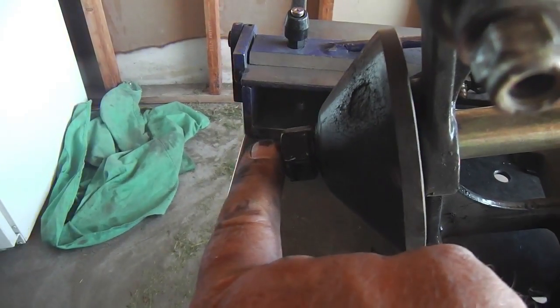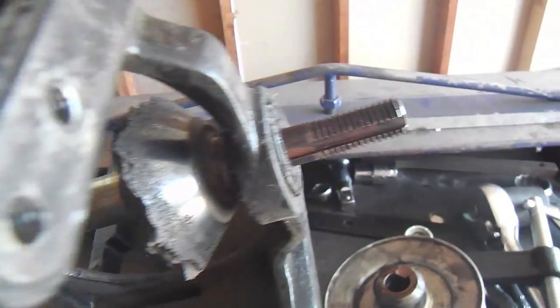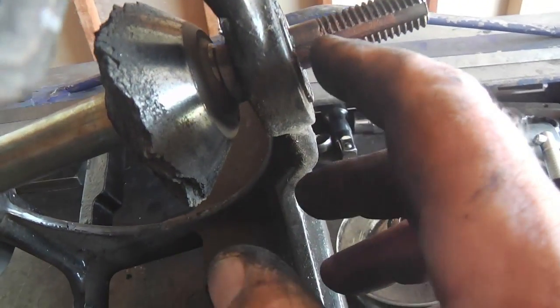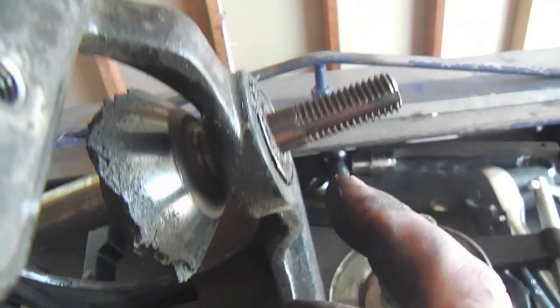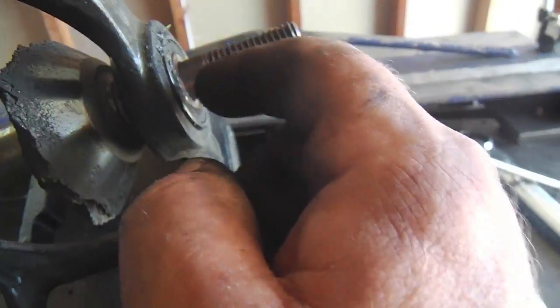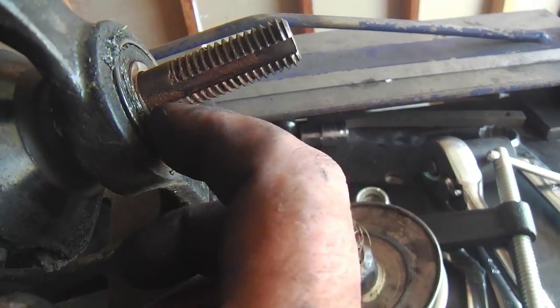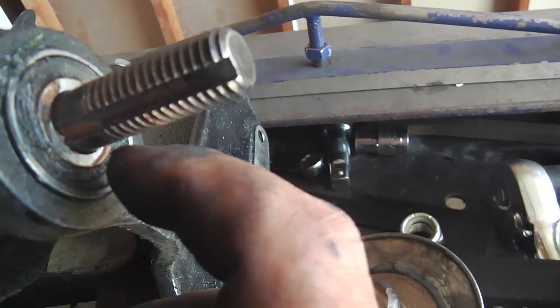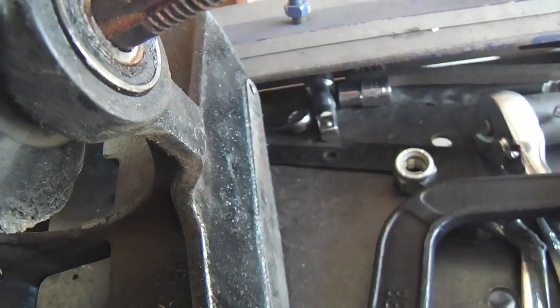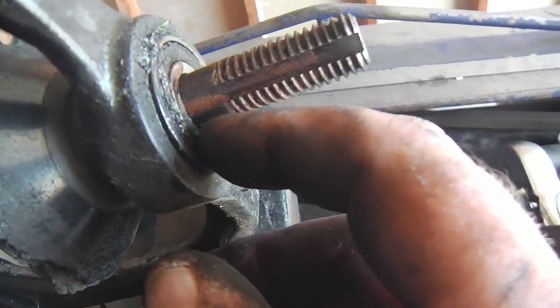You just tack that nut down here, that keeps it in place. It doesn't wander up and down when you're tightening both ends. And then you ensure that there's the utmost unthreaded shaft. And in the literature, it calls for a washer spacer, a small one right at the end. I don't use that either. And you can see that I've chamfered this pulley at the end so it doesn't impinge on the bearing at all. It just seats up to the inner race portion. So that's not a problem with it being right up to the bearing, because it's impinging only on the inner race.